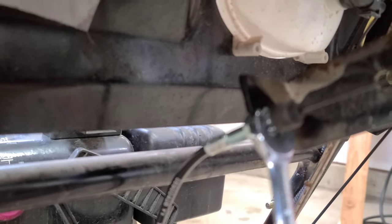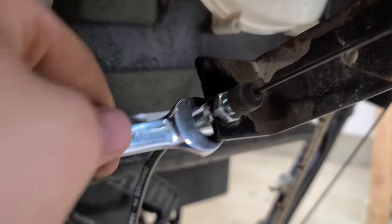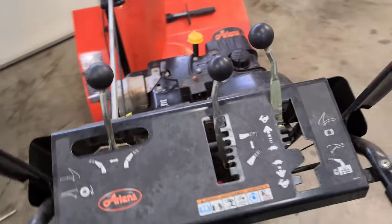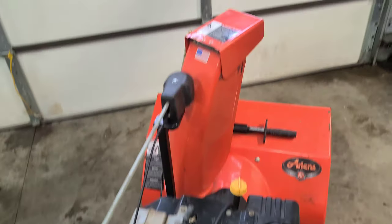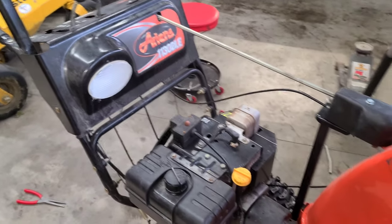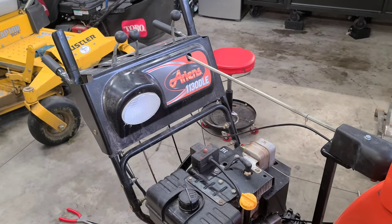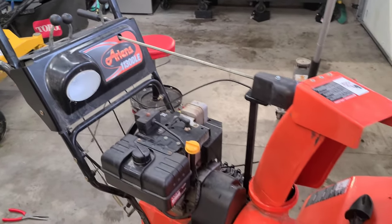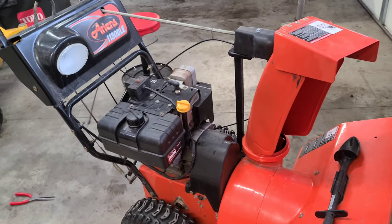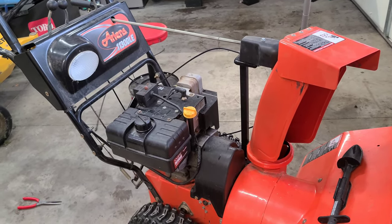So we're going to go ahead and take our half inch wrench and tighten up the nut there. You don't need to torque it down — it just needs to be held into place. The back one obviously tightens up as well. So that's basically how you change out a chute directional control cable on an Ariens 1130 DLE snow blower. I hope you guys enjoyed the video. Let me know in the comments down below if you guys have ever replaced one of these, and I would appreciate if you hit the like button if this video was helpful and informative. Be sure to subscribe — we do have some more tool videos coming out, some more small engine repair on the way. We also have a podcast where we talk about starting a small engine repair business — the basics, the problems, the prices and whatnot.